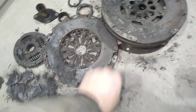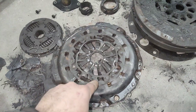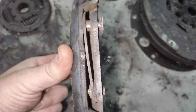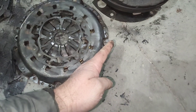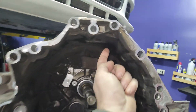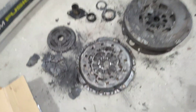Let's see the new parts. I've decided to switch from the Luk self-adjusting clutch, which basically has these springs in it. When these things fail, the side do-hickeys — these plates — those blades get pushed to the edge and the centrifugal mass will spin it so hard it actually turns into a saw blade, and it ends up cutting the bell housing all the way around like Swiss cheese.